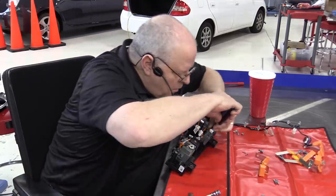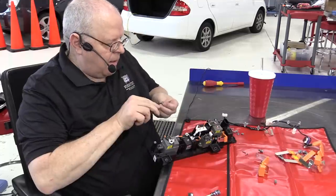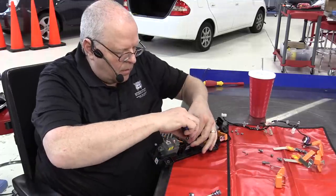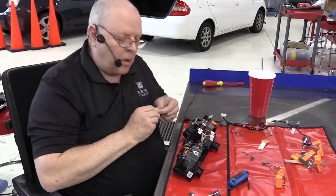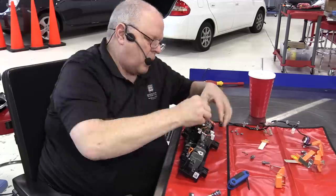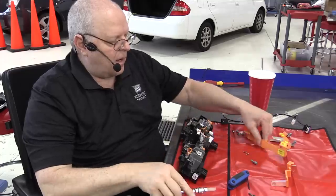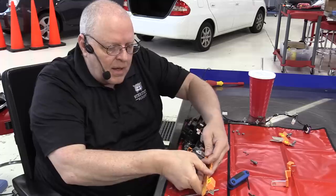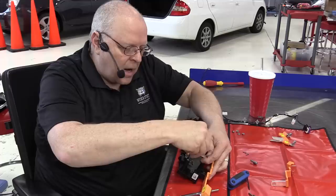Okay, we'll get our pre-charge contactor bolted down and our charging system contactor. Now we can connect our little wire harness to our charging system contactor. Hook our bus bars up to our negative contactor through the pre-charge resistor harness. Then we've got a bus bar for our positive contactor. Okay, next we have our overall battery positive terminal connection to the contactors, and this will connect the positive contactor to the positive terminal of our big high voltage battery pack that we just reassembled.